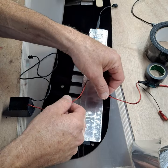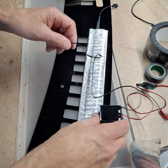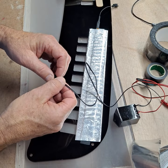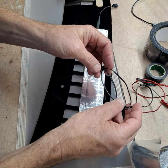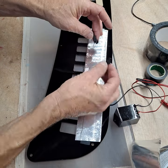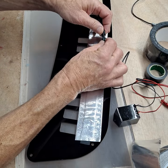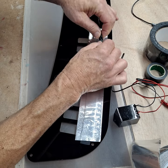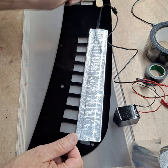It has a one amp fuse. Very thin wires — be careful of them. This inverter will convert that 12 volts DC into AC voltage, so it is a high voltage AC situation. It's all very protected with quick connect clips — you just clip that together. And as soon as you supply power, it's going to light that light strip up.